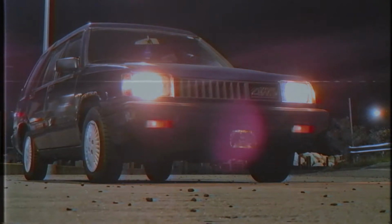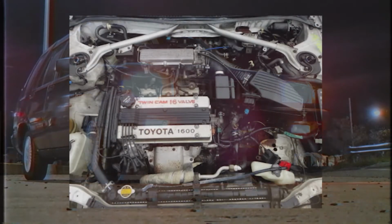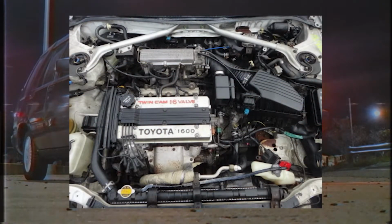Wrong. The problem with this swap is that in my province, Nova Scotia, I was having a lot of trouble tracking a 4AC down, and even if I found one, it would need a lot of work. The next option I looked to was using the revered 4AGE. The main problem with swapping one of these in is that only very early examples of these motors use a 6-bolt flywheel. That being said, there is a way around that.